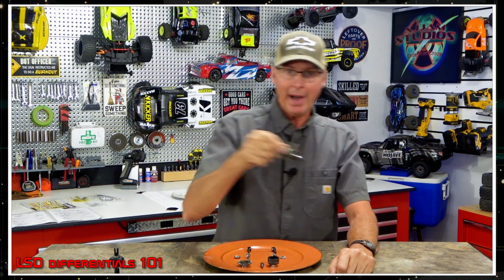Okay, in that situation, a thinner fluid wins. But too thin is not a good idea. You need to find what fluid works for your application. But thinner in that situation to bleed off a little extra power, that helps. Beside that, however, look at it this way. If you can keep the front end from flipping over backwards by lightening your fluid some, when you pile into the brakes, it's counter to what we just talked about.